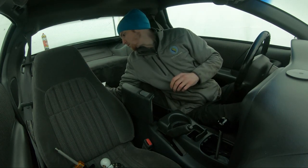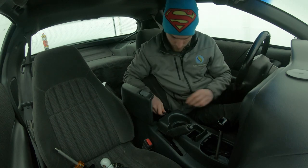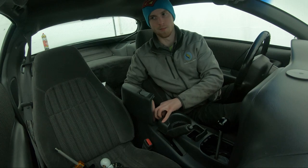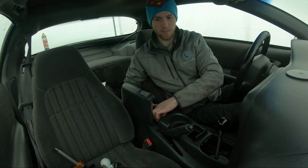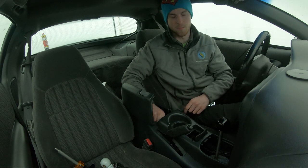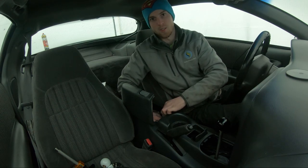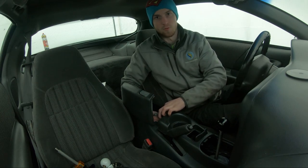It's been probably like two years since I've done this, so sorry if I mess anything up or if I don't remember anything. This will probably be the last mod I do on the car until I save up enough to buy the big mod I'm getting ready to do next. It won't add any power or anything, but I want to get the Holley EFI Terminator X — it's like a whole new ECM — and I want to get the dashboard kit. That way I can do all the other mods I need without getting it tuned every single time, like if I want to do headers, the EFI will adjust the air-fuel ratio so I'm not running lean.